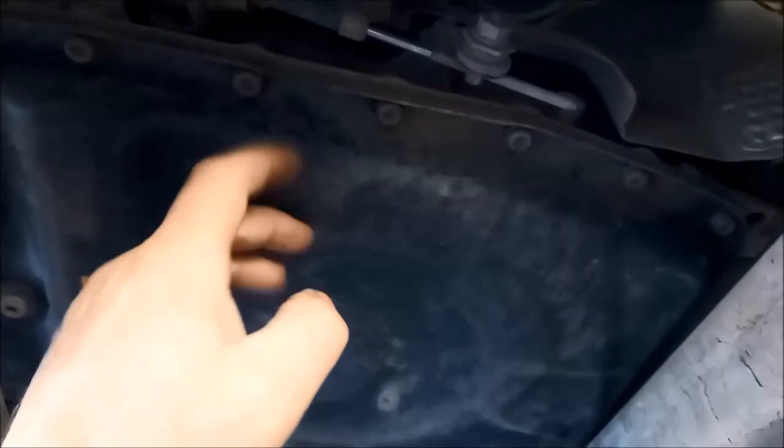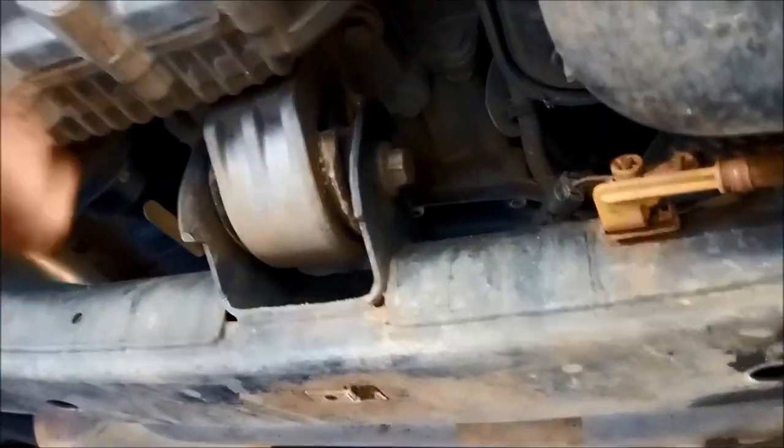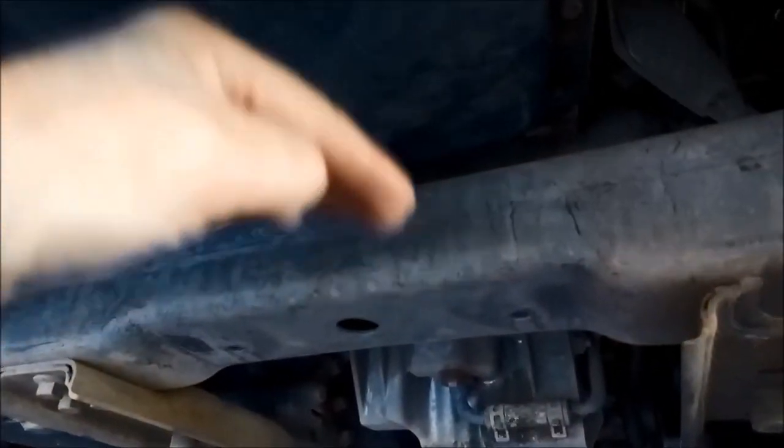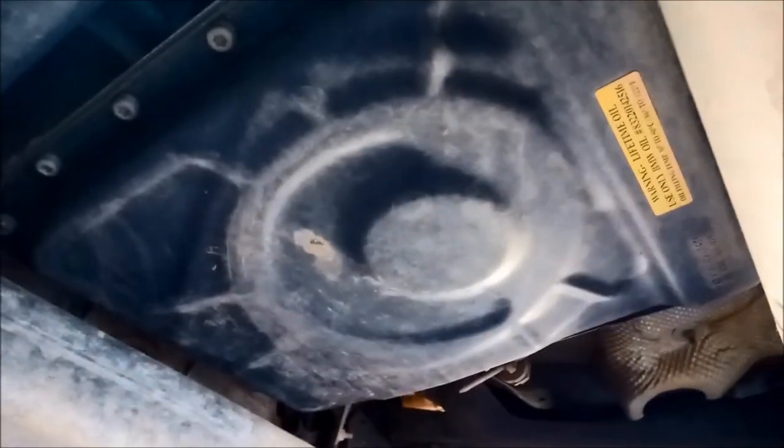This one's already had the upgrade kit on the pan. We're removing the valve body, so we might even need to take off this exhaust to be able to get the valve body and the pan off. You can try undoing this bolt here and then jacking up the back of the transmission — that'll move it away from that cross member at the rear and also at the front, giving you a little bit more room to maneuver. But before you start any work like that, just make sure you give it a good clean and get any loose road dirt out of the way.